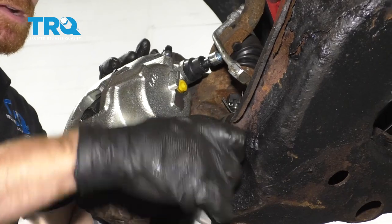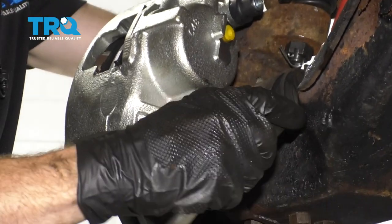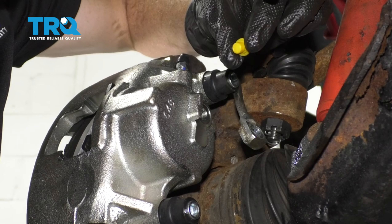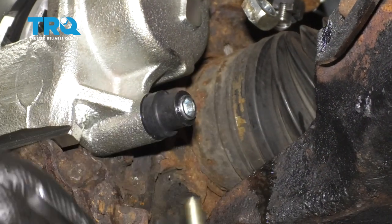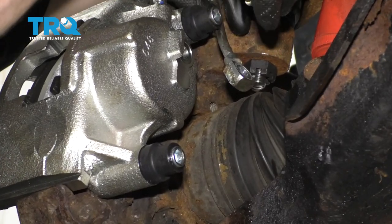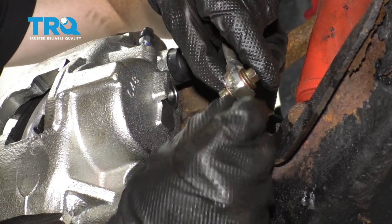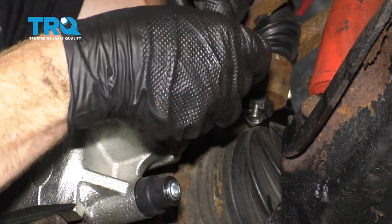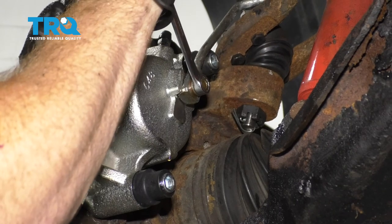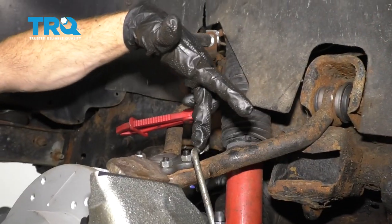Make sure the flex hose is out of the way. Let's carefully start in both of these bolts and then snug them up. Remove the protective plug from the backside of the caliper. After you drain your old caliper, go ahead and install this. Clean and inspect your banjo bolt. After that, take one of your brand new crush washers or gaskets and slide it right on there. Take that banjo bolt with one of your gaskets on it, slide it right through the flex hose, take your other gasket and slide it onto that banjo bolt on the opposite side of the flex hose, and then connect this into the caliper. Let's snug it up — it's pretty much bottomed out. Give it a little bit extra to make sure we crush those gaskets a little bit — that's gonna help make sure it seals.